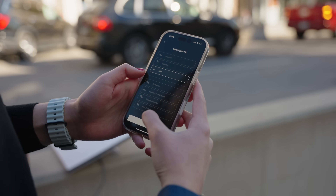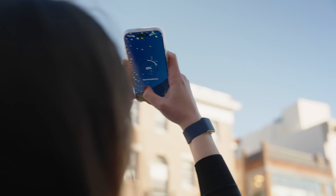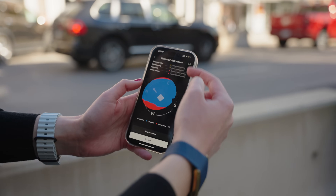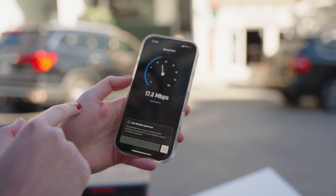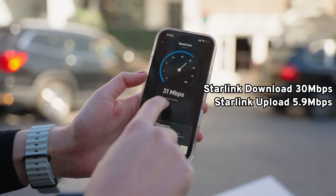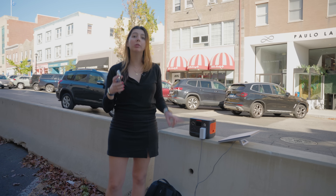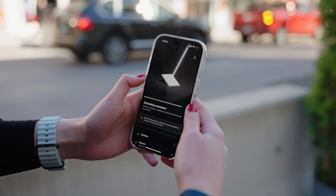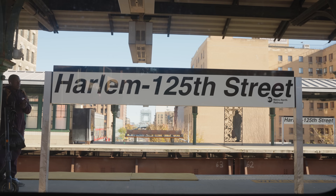The next step is going into the town of Greenwich to see how this performs. After checking for obstructions and scanning the sky, the view results look pretty good — semi-clear in the center, red on the sides. Starlink connected — that one was fast, and this is in the center of Greenwich, more of a city area. We're getting 43 millisecond latency, 30-ish down, and 5.9 up, in the middle of a street with tons of cars and buildings flanking us on both sides. I'm getting better at understanding the setup process, and the Starlink seems to be calibrating more efficiently.